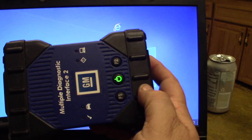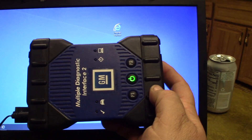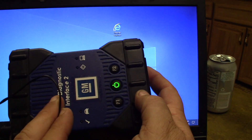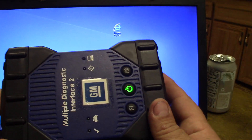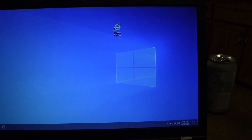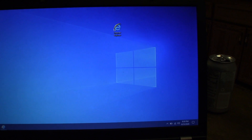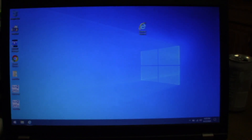When you're programming, plug the AC adapter for the laptop into a power inverter in another car and run an extension cord over. The reason I do that is if there's a power outage in the middle of programming, I'd be solely dependent on the power from my OBD2, which I don't want. But really those are the gotchas — it'll program modules just fine. It comes with a USB cable and an OBD2 cable; I'll leave a link below to where I got this.